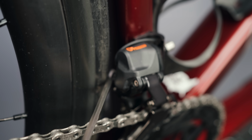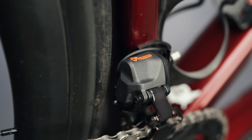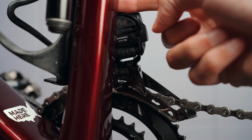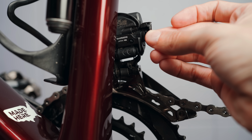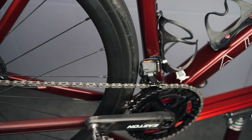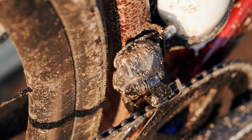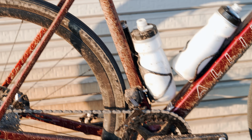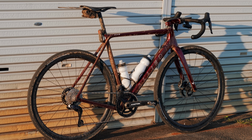in my experience. Now, it's still a pretty tight fit, so I decided to reroute the Di2 cable over the front derailleur, skipping that little plastic wire guide. That cleared up some more space behind the derailleur. And while I would prefer even more space, especially if it turns out to be muddy, I did a pretty nasty ride just to try everything out, and it didn't clog up there, at least for me. In normal use cases though, I avoid mud like the plague, so I don't think this will be a bigger issue for me personally going forward.